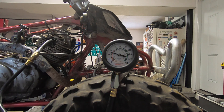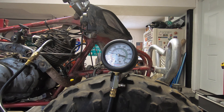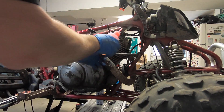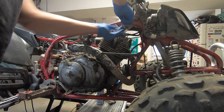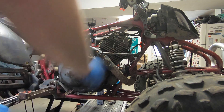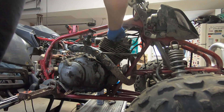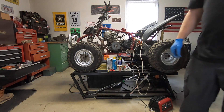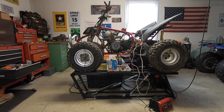I could try putting a little fuel down the cylinder to see if it'll pop off, but I don't think it's going to. This thing is going to have to crank over super fast to fire off on low compression. Let's shoot a little bit of fuel down in there — the rings might be stuck. By the way that plug looked, I'm going to say the top end is junk. Nope. We are too low on compression for this thing to start. It looks like we've got a rebuild on our hands.